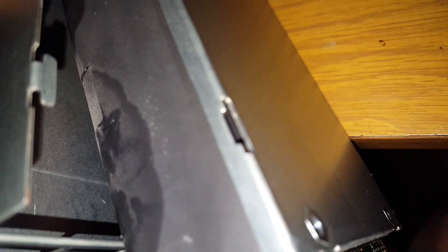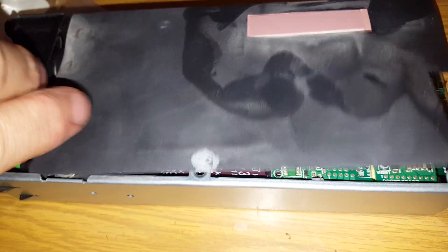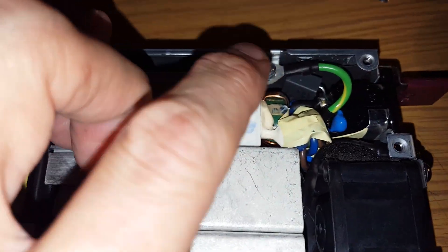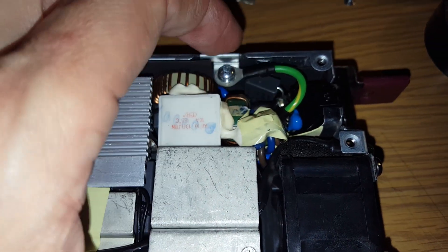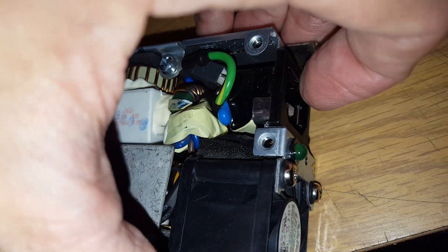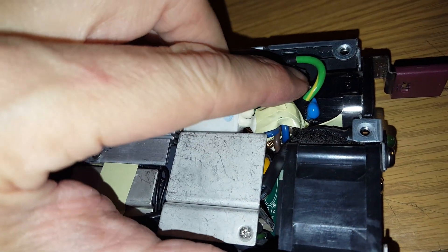There are a couple of little bits right there — see those? Those fit in those, and there are three of them along the rail. That just hinges off. Set that aside, flip the cover up, turn this around. The next thing to take out is this screw, and once this screw comes up, this power connector just lifts up and out of the way — and that exposes another screw underneath.